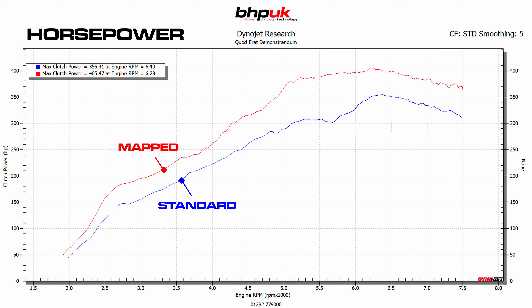Quite importantly, the cat temperatures, just to make sure the exhaust gas temperatures are running nice and cool as we want them — and they're never running over what the factory has set them to. We'll get it run up, see what power it's producing, get the data that we need, and then we'll come up with the tuning strategy to suit.